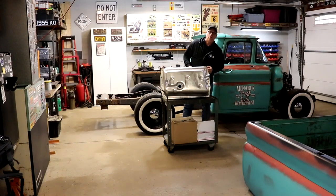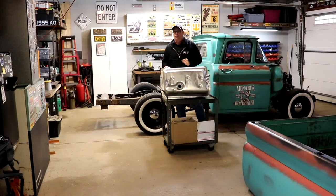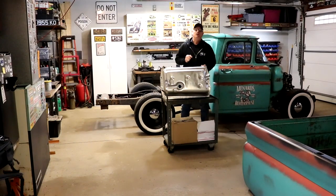Fine, you say, put an external pump. Have you ever heard those? They sound like little jet airplanes under your car, and to be honest, that's not what we want. You don't hear fuel pumps in modern cars unless you listen very carefully, because they're in the tank.